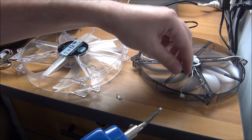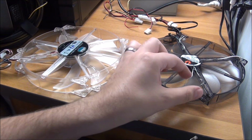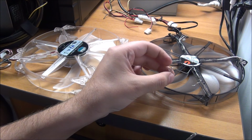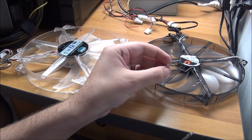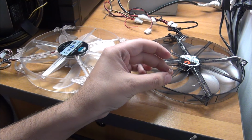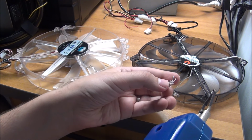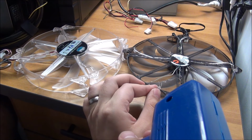This is down. And for this one we have a problem right there, because the wires are identical, so there is no way to tell which is which. But I do know that at the moment, on the wire that we are still connected to, we have soldered the big part of the LED. So it means on the one that is not soldered, we need to solder the small part. So that will be quite simple.